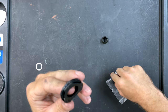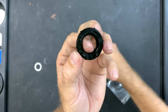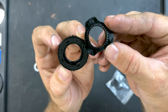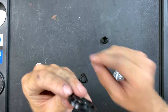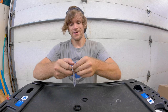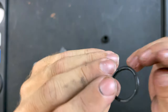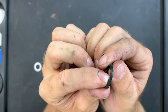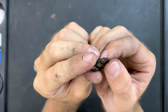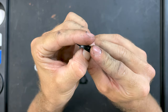All we've got to do is use our fingernails to get this c-clip out — set that aside to a safe place. Then we're going to slide off the metal spacer piece that keeps it together. We'll pull the spacer out from inside the clutch assembly. This is the spacer we have a replacement for. Let's take the triangle piece off — you can see the four little gears on the inside and the wedge and its gear piece. We've got to take this o-ring out. Then we'll take one of our new o-rings — let's make sure they're both exactly the same, which they are. There is some difference here: if you look closely at this o-ring, you can see there are little ridges on it.